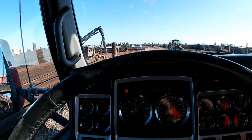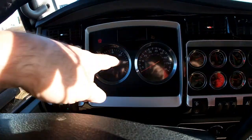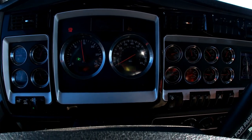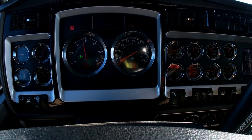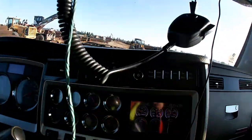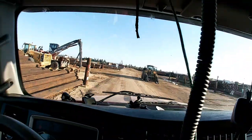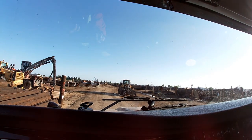This is why they recommend trying to get out on the road and drive when you get that light — that's why they want to put team drivers in all these trucks, so the truck spends more time driving than parked. Parking it and idling it are the death nail of these DPFs — that's Diesel Particulate Filter. Once this thing starts I hate to stop it.